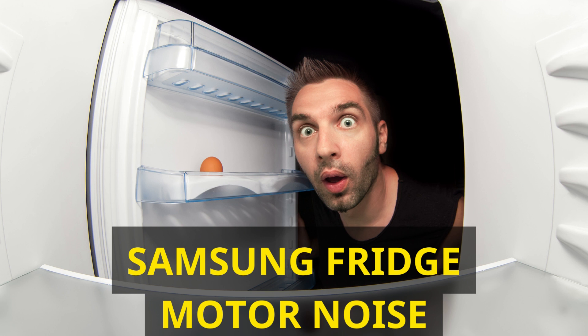Common causes of fan noise and troubleshooting: if defrosting doesn't resolve the issue, it's time to dig deeper into potential mechanical problems. Fortunately, most of these issues can be traced near the fan area. Here are detailed troubleshooting steps. Frozen or damaged evaporator fan blades: ice buildup around the fan blades can lead to noise. While defrosting, carefully examine the blades for damage. If they are damaged, the entire fan assembly may require replacement.